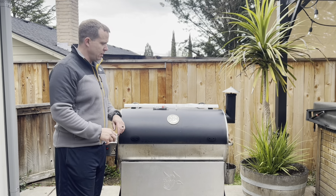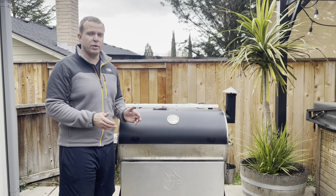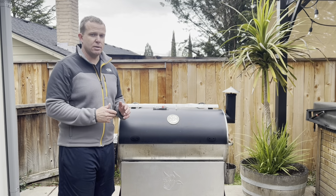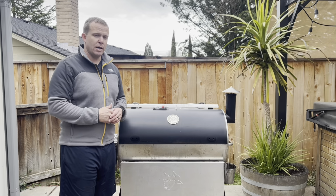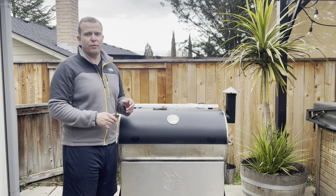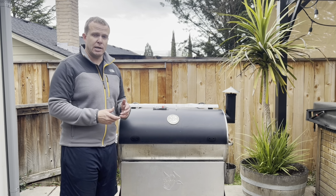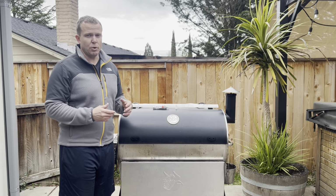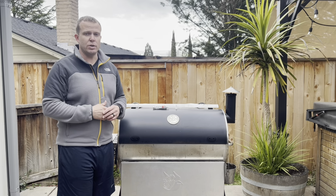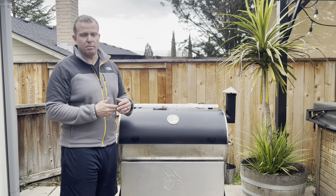You'll open up the lid. Preferred would be a Phillips P3 head. You can make it work with a Phillips P2 screwdriver. And I would definitely recommend in most cases using a manual screwdriver, because when you go to put it back together, getting everything aligned, if you aren't careful, you can cross thread those screws and potentially break them off in the handles themselves. I know some owners have experienced that during their initial installation, and so for that reason we do recommend the use of just a standard manual screwdriver versus a power drill with a bit.